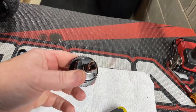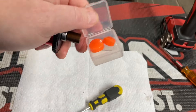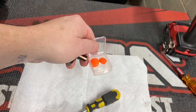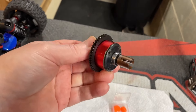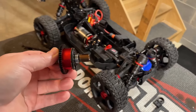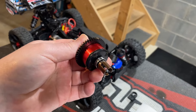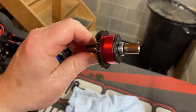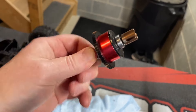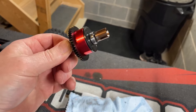Unfortunately it was the route I wasn't really trying to go, but these are what I use — silicone earplugs from Amazon. I used about half of one, just jammed it in there. I didn't want to completely stiffen it up like I usually do, but it'll tighten it up quite a bit and should distribute the power equally to front and rear wheels. After I kind of put it back together and felt it I didn't like it, so I put in the rest of the earplug — I've got one whole earplug in here now. She's pretty stiff but not fully locked up, so I think it'll feel good.